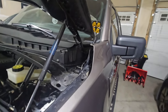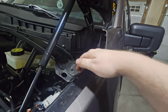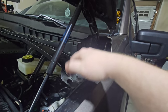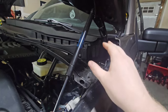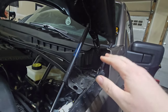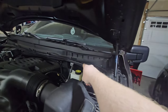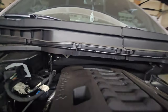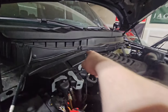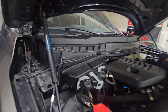I ran my wire through the hinge on the inner side and it does not look like it's contacting anywhere — I'm going to keep an eye on it. The reason I didn't go through the fender here, which probably would have been the best, is that the hood doesn't protrude below this line from what I can gather. That's a really good spot if it stays the way it is and doesn't contact anything. I ran the wire all along the cowl — you guys can see it. I just used about four zip ties on these factory clips for the cowl, and it worked perfectly.